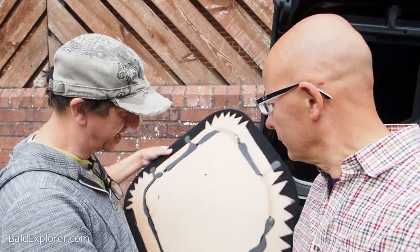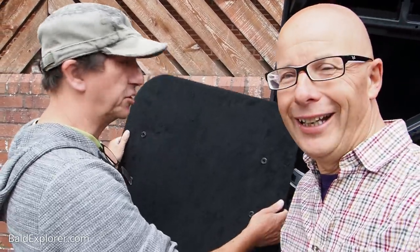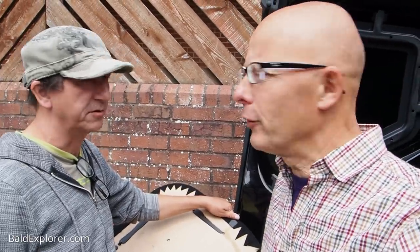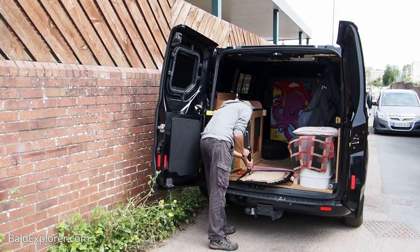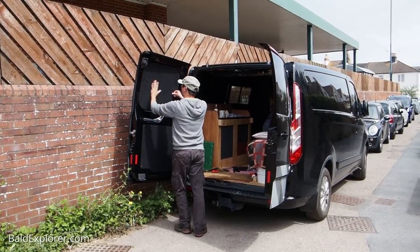So as you saw, the panel fell off — I took it off and it needs replacing. How are we going to do it? What we're going to do is we're going to have to take some of this existing sealant off, because the clips that hold it in place, they are broken — knackered, because you yanked it off, didn't you? I did. I was zealous. You were keen to see what was behind it. Well, nothing now. One could put insulation in there — you could fill that with insulation — but I'm not going to bother at the moment. So what we're going to do is take this existing sealant off and put some fresh back on around here, which you just fortunately happened to have brought with you. Then we'll plonk that back in place, put the clips back in, and that should be that.